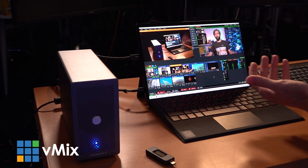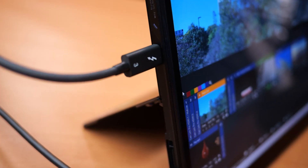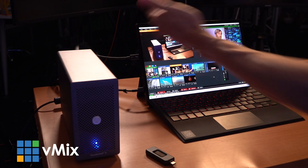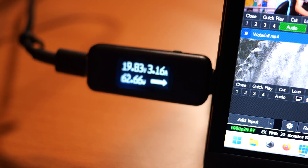So I decided to get the Z13, and when I brought it back to the office, I plugged it in with the only port I could see. I was wondering how I was supposed to get anything else into it, so I went around and found a rubber connector cover — that's where you plug in the external enclosure. There's also a USB-C connector for USB 3.2. I figured I'd plug power into that so I can use the other one for Thunderbolt. I grabbed my USB-C power meter, tested the power throughput on both ports, and it was getting the same power draw — so I knew I was going to be okay.